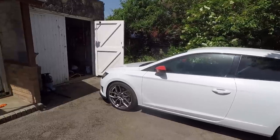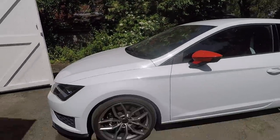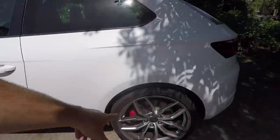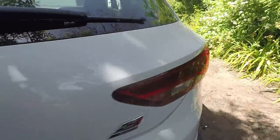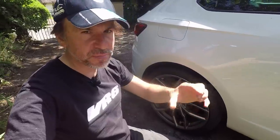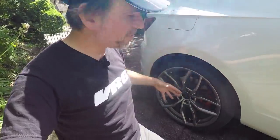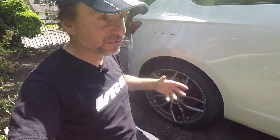I left it a bit late to fit. I started on Wednesday, and today's Friday, and came across a problem. They're on the car and the last thing to do was bleed the brakes. Starting at the first corner went fine, but on the rear original caliper, the nipple was rounding off even when using the proper brake caliper spanner that goes all the way around the head. Even so, it rounded off. I thought no big deal as I had spares — but when I took it all the way out and tried to get the new one in, the thread had been damaged, leaving me with a useless caliper with fluid coming out.